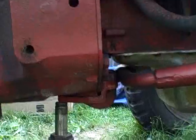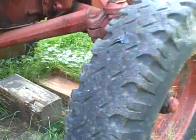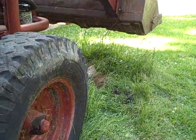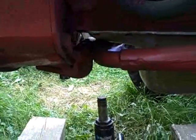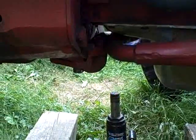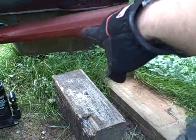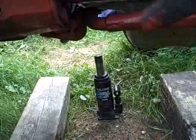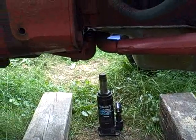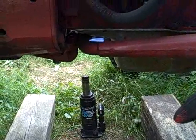The leak might be right where that union is on the bottom of the gauge. The jack pushed it back up but now the holes aren't lined up. It occurs to me that if I want to move that around, I probably want the weight off the front axle — I should drop the loader back down and try to lift the front end a little with it. I got one of the bolts in but I'm having a hard time getting the other two holes to line up. I remember I used a big pry bar and pried down on this member, which loosens it up so you can move it around easily. I need to get my pry bar, which I don't have with me.